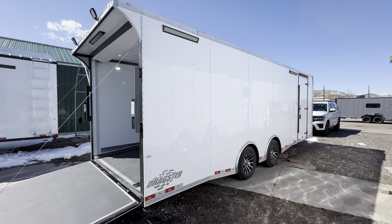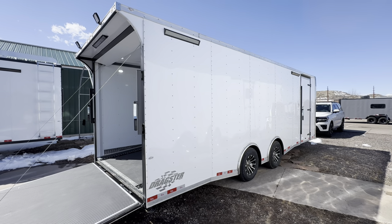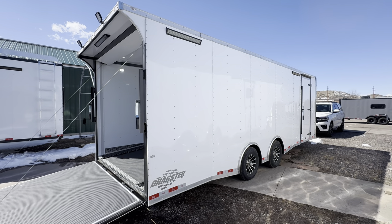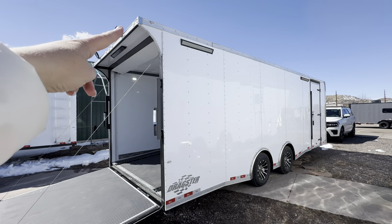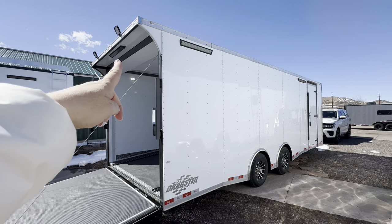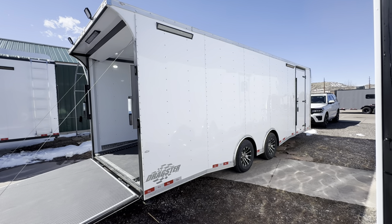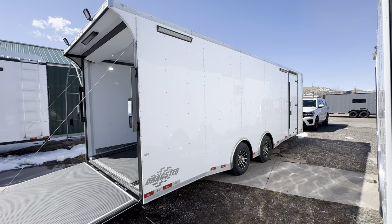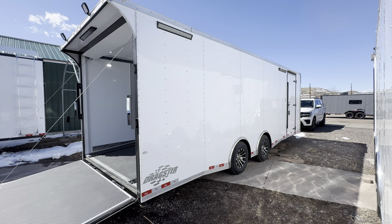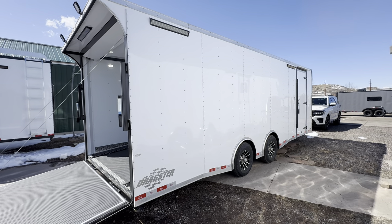This is an eight and a half by 24 with a seven-foot interior height. We've got a lot of great exterior lighting on this trailer — two nice big light bars, two directional load lights, and another light bar. It also has the rear wing on it, so it's a really nice-looking trailer. It has a thicker aluminum skin — .040 exterior white — and it's framed out 16-inch on center on the wall, ceiling, and floor, so it's built correctly.